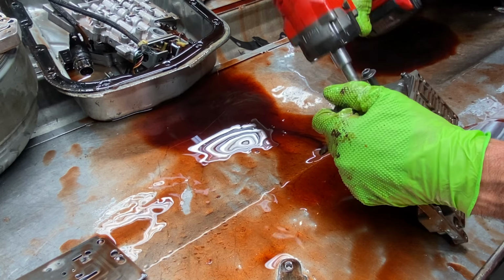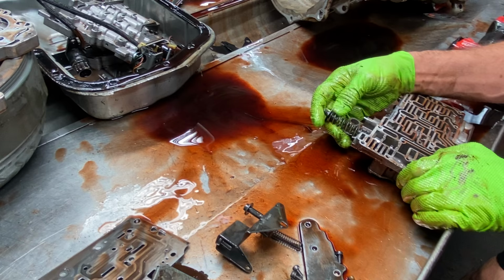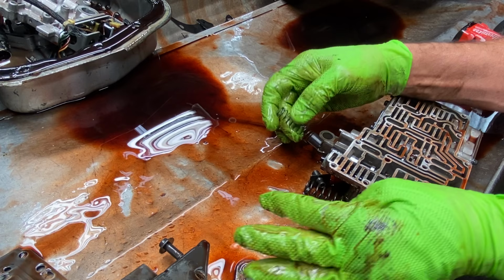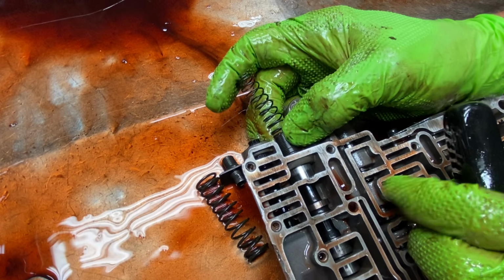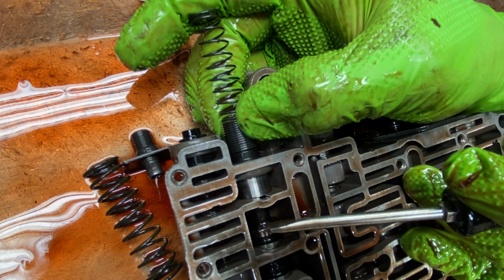Now, we use a ton of these, and from the grapevine, I talked to a lot of people. Transgo has its own full-time lube circuit built into this spring and valve and these little retainers right here. You can see these, that and that, and this little center spring right here. This little spring right here is a floater spring, and it allows this valve at idle to kick back just enough to open up that circuit right there. Can you see that right here, Teresa? Now this spring here is what I call a lube floater spring. It lets this valve float back just enough to let that land right here peek through that edge right here. Just like that. Just barely like that, right?